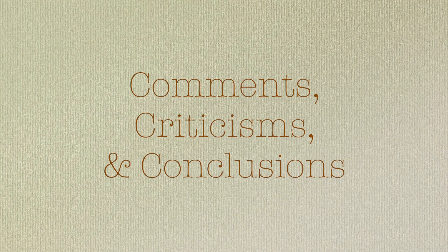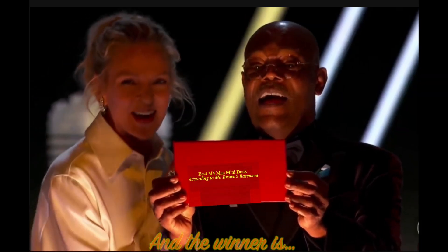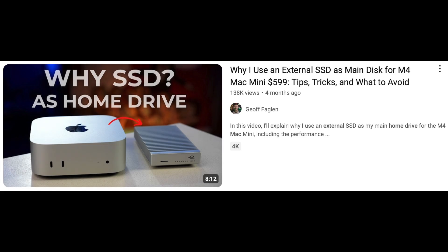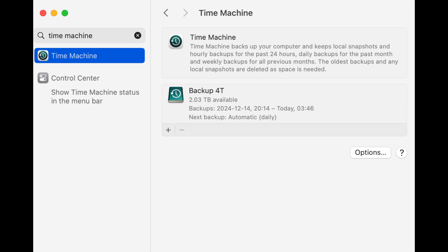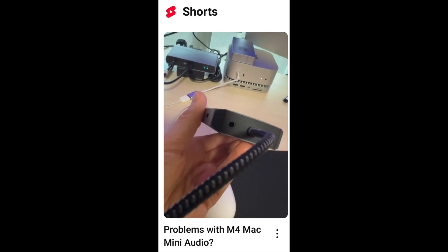Let me know what you think in the comments. I really wanted to say one product or the other was the best choice, but that's simply not true — which one is best depends on what you're looking for. If you want top SSD speed, the Jawocli dock with its USB 4 host connection vanquishes the RayQ dock, hands down. Suppose you had your home folder on an external SSD mounted in this dock — it would be light years better than the same SSD in the RayQ dock. But I use the external SSD as a Time Machine backup, and backups rarely take more than a minute. If you're looking for connectivity, then the RayQ dock is better — no comparison. With video output, USB-C, and card readers, it's just so much more useful. However, if you already have that connectivity provided in a separate device, the extra ports are of no benefit. Incidentally, if you have a dock and can't get it to activate the headphone jack, I have a video for that.